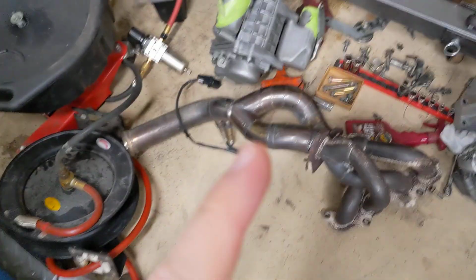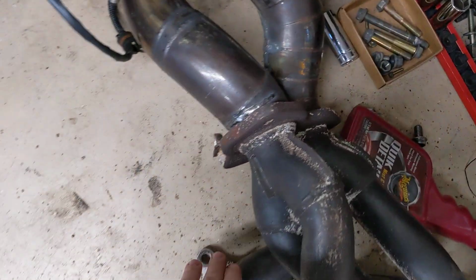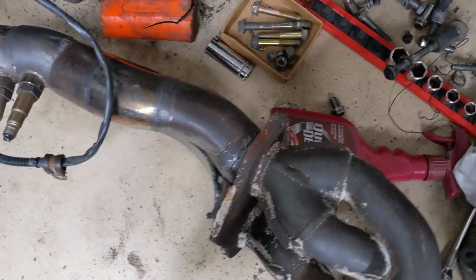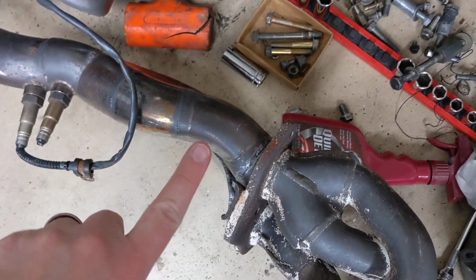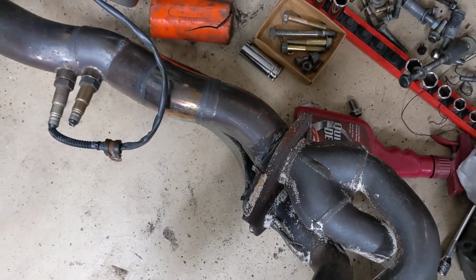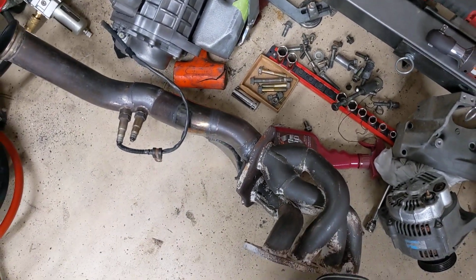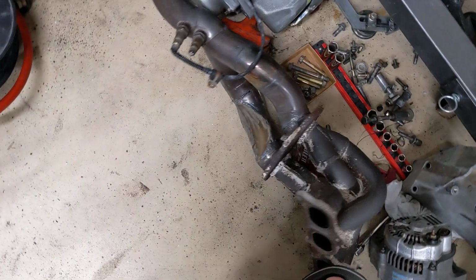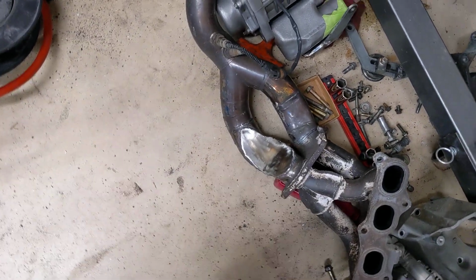And the other thing too is that if you have your steering rack relocated forward for steering angle so you don't over center if you're a drift car, then you've got even more problems. So I had my buddy make this for me, and I'm just gonna show you. This is how it's made to clear the steering column, the steering intermediate shaft that goes right through here. Mine was made from before I relocated my steering rack, and then I relocated my steering rack forward, and then I had to do some modifications to it.